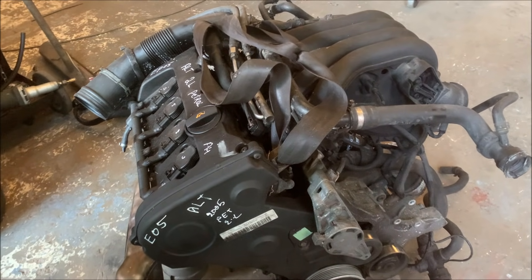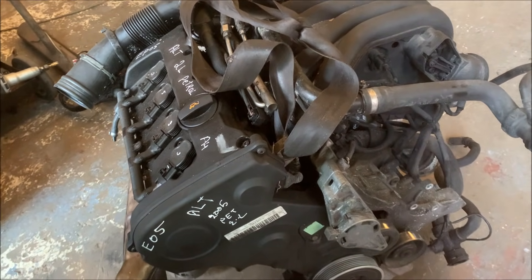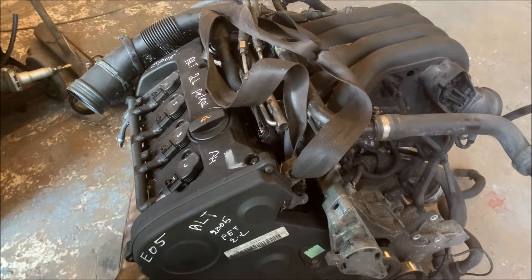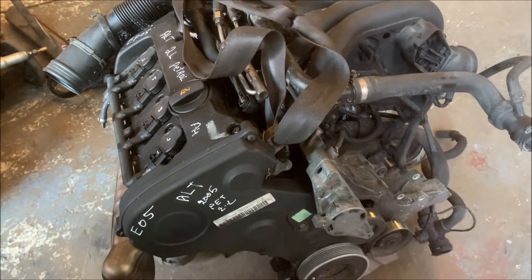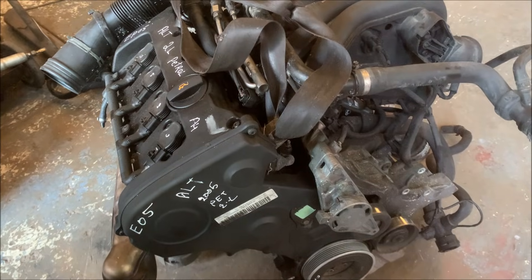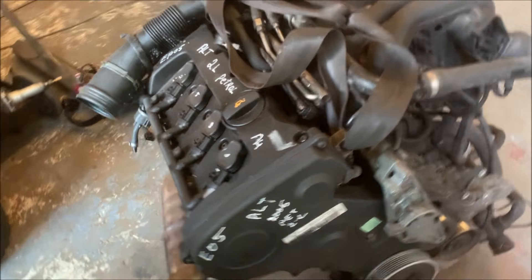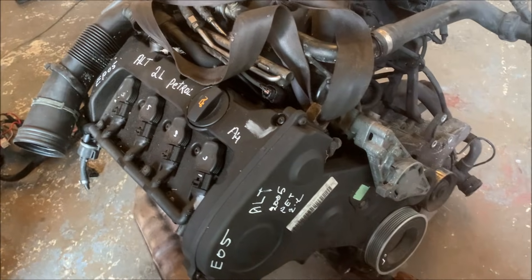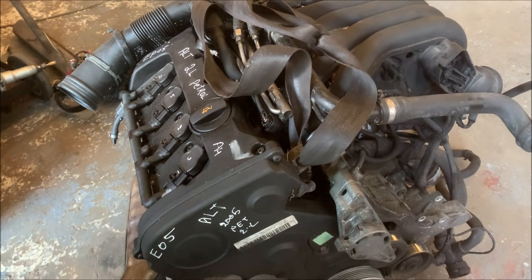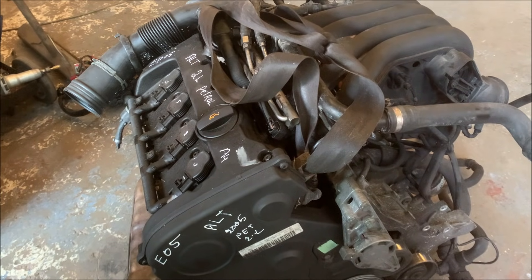All I've got is pictures from researching them - literally just looking at pictures of them for sale, broken for spares - and thinking hang on, a lot of this is practically the same as a 180. As far as I can see in pictures the block is a 180 aluminium block, probably not strong enough, but I didn't buy this for the block. The head looks like a 180 head to me - different cam cover but looks like a 180 head. It also looks like it's big port and I'll be interested to see what the cams are.